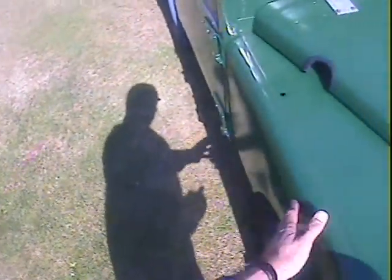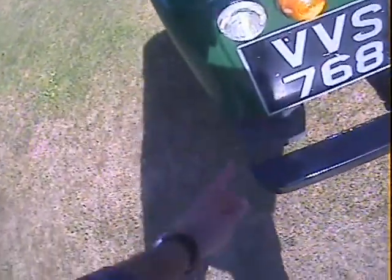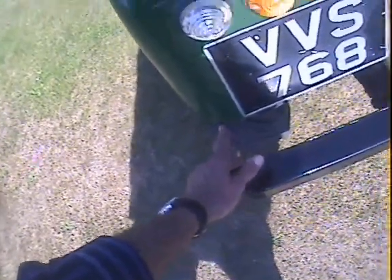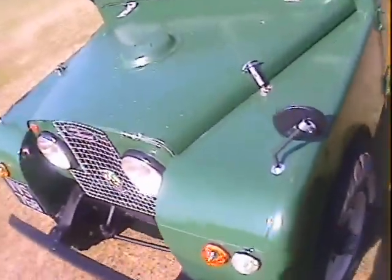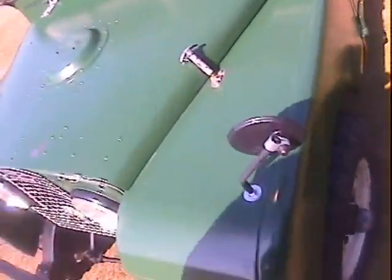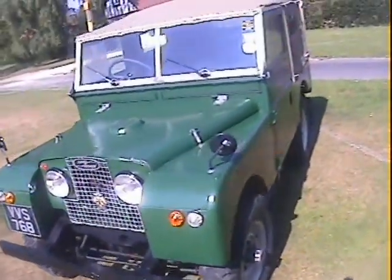Panel work-wise it's beautifully straight. I think these wings are probably the originals, but there's one or two minor waves in them. It's not a horrid dented mess the way that some of them are these days. The only fault I can find is just a little nick out of the front panel by the nearside front number plate — just a bit of a nick in the aluminium. Both sides look nice. It's been sprayed by the look of it rather than brushed or rollered, slightly orange-peely finish but not bad. Beautifully straight again down the nearside, and up around the bulkhead and scuttle it looks superb.